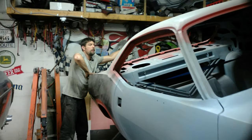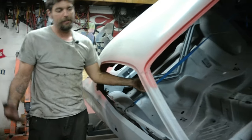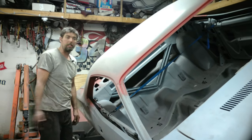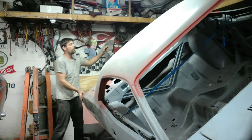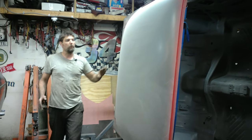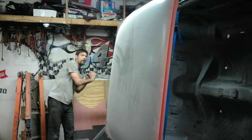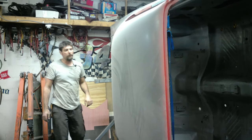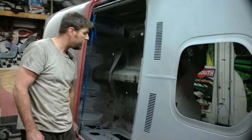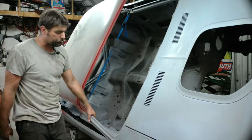I put a strap around the doors — it's not tight, just a safety measure. If you're putting a car on a rotisserie, not a bad idea in case anything lets go. You can see a lot of dirt still coming out of the car. We'll do some work on the roof as well — it's not perfectly balanced but we'll work on it — and the same with the hood. That's pretty much the car on the rotisserie; it just makes the bodywork and everything easier.